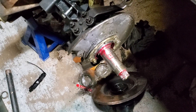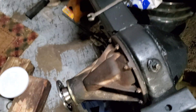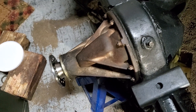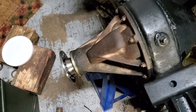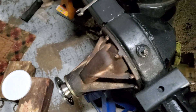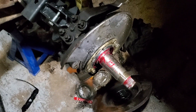That's where we are on the 4Runner — about to get a front end in it. In case you missed the other videos, this is a Detroit Truetrac differential, built with a 29-spline pinion and conversion bearings, so it's locked, with 4.56 Yukon gears to match the rear.